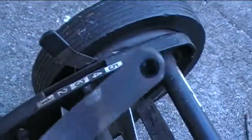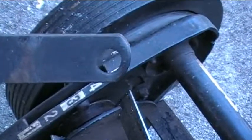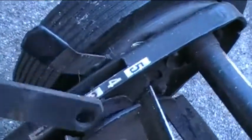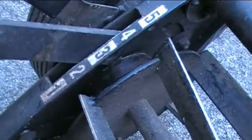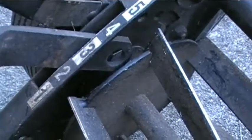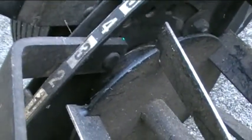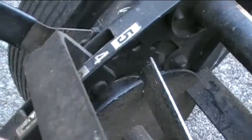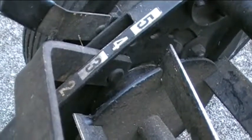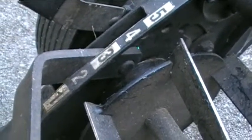Okay, but the reason why I have to bolt the two halves together while it's in the lawnmower is because of this. As you can see, the old handle brace has this little hole in the end, and what I'm going to have to do with the new one, actually both of the remaining handle braces, is slide them in that little slot right there, and then that hole will fit over this little peg down there. Okay, and that peg allows the handle assembly to pivot up and down depending on your height and your distance from the lawnmower.